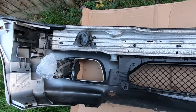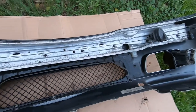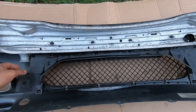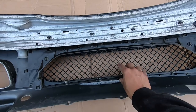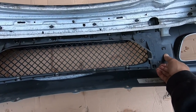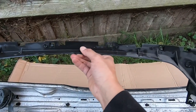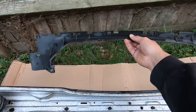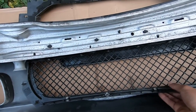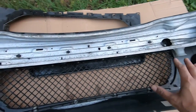While I've been cleaning the back of this bumper I've been unclipping this part of the grill surround, which helps hold the other piece in place. I'm going to work my way all the way around and unclip it, then get that piece off and give it a good clean. Now this piece is off we're going to set it aside — it doesn't come new with the other piece I bought, so we'll reuse it. Then we're going to do exactly the same and unclip the actual part of the grill we're going to replace, all the way around.